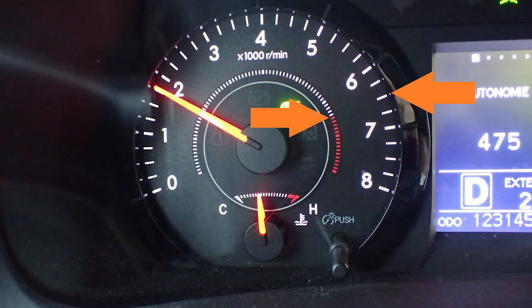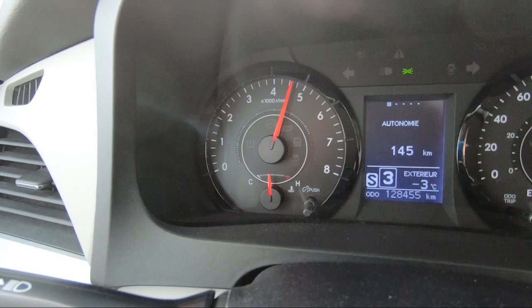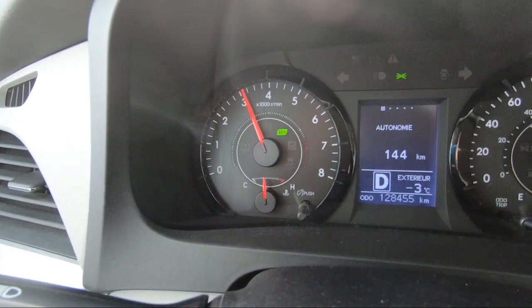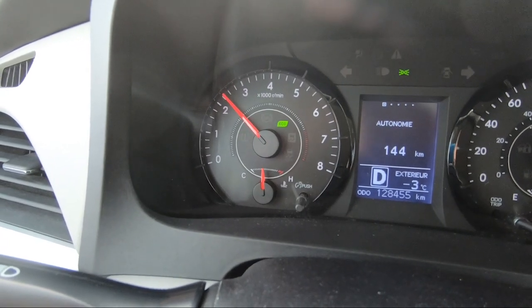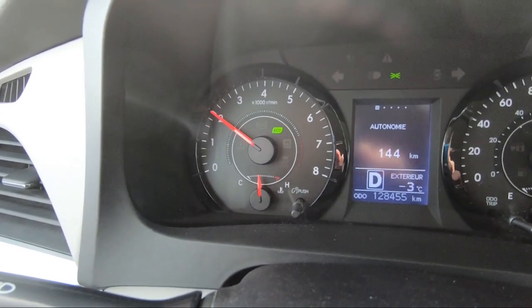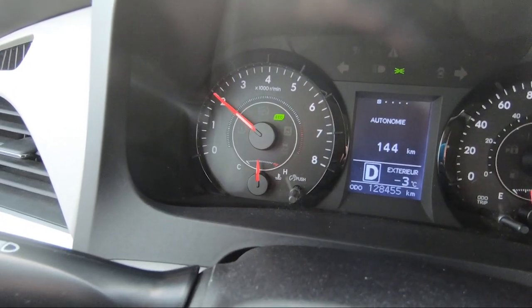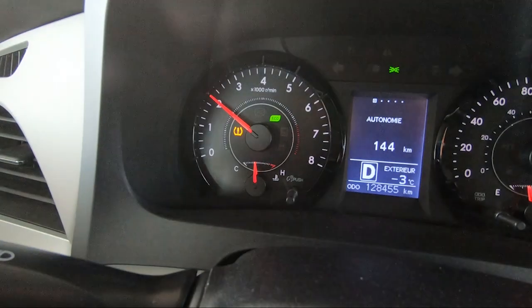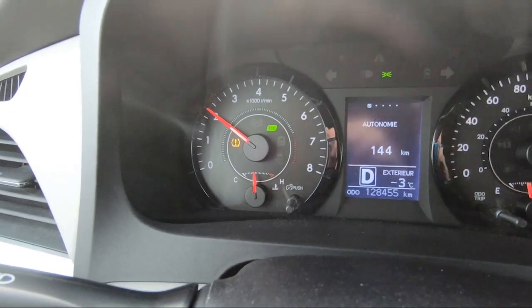My maximum RPM indicated by the manufacturer of my vehicle is 6500 RPM. So I try to always stay lower than approximately 4500 RPM. If I do not stay within those minimum and maximum range limits, I can damage my transmission or my engine. Every engine is different and has its own specifications. It is important to obtain them.